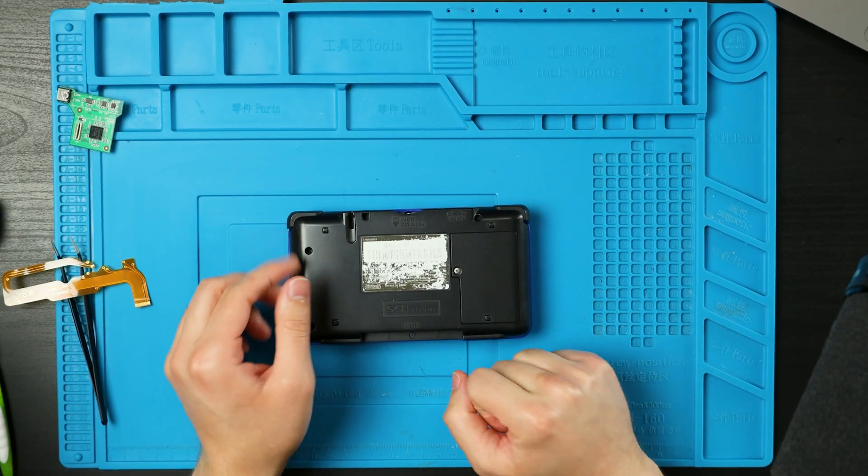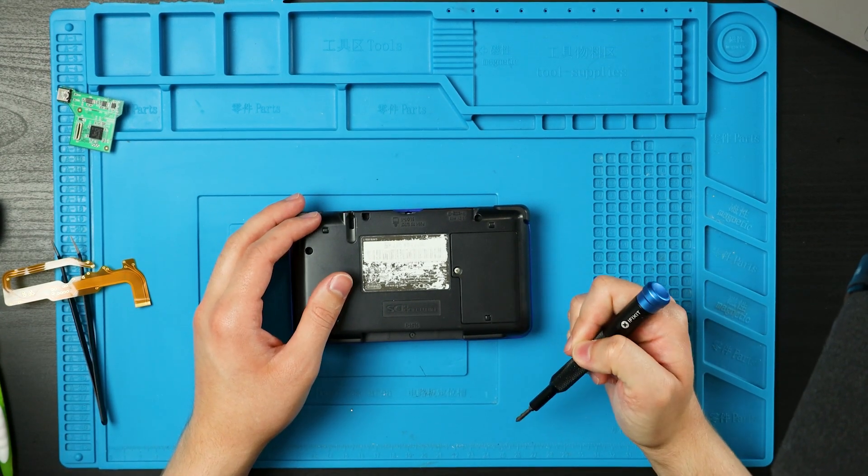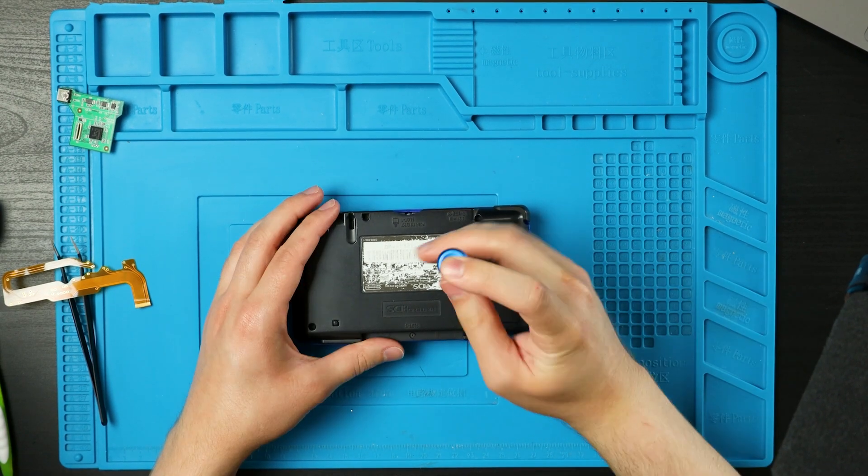Even I've had a hard time recently with a similar soldering job, but since then I've learned from my mistakes. This mod went very smoothly other than the trimming, and I'm ready to teach you how to do it. We're going to start by taking off the battery cover. In classic DS fashion, there is a Phillips screw here, but the rest of the stuff we're going to be working with is the tri-wing. Then we'll go back to Phillips on the inside — technically it's a cross head, but it doesn't matter.